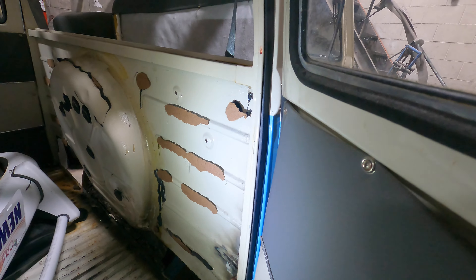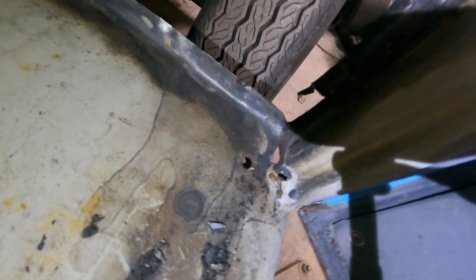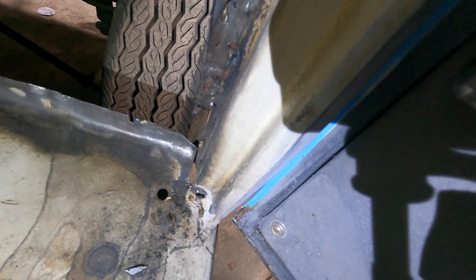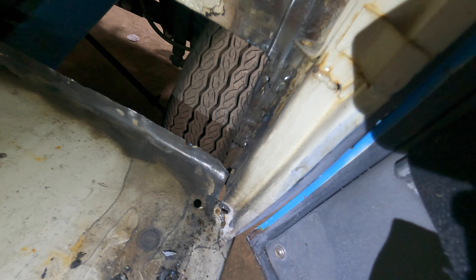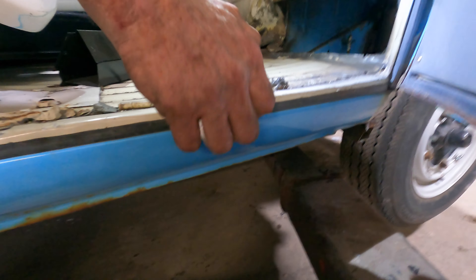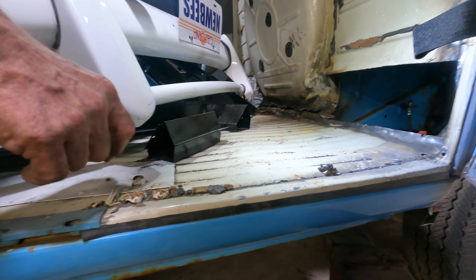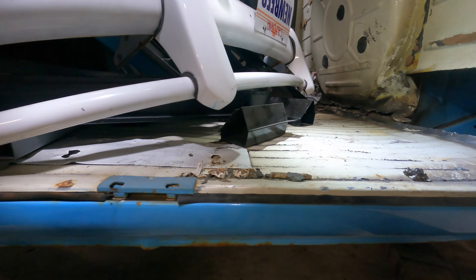If you look up here it still has issues up there too. That's called a B-pillar. You can see in the corners they didn't weld it — it's not been welded anywhere. The front was not welded at all. You can tell right here, I could take my fingernails and move it — I shouldn't be able to do that. And it sounds like a tin can. If that was welded you wouldn't hear that.